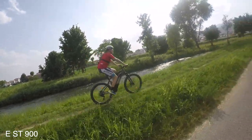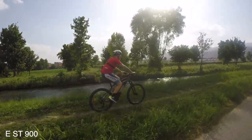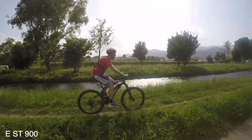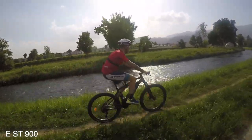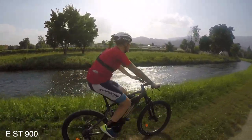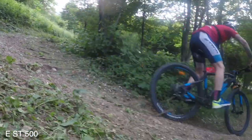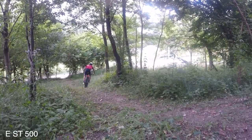This is something I had initially underestimated about this bike, but after riding it I changed my mind. The feeling I had with this tire was really great compared to the ST500's Cougar 2.4. Both wheels are 27.5 inches; on the ST900 it's 27.5 Plus for that extra width. As I mentioned in the review videos, on both bikes you really need to experiment with tire pressure, as changing it gives a very different riding feel.